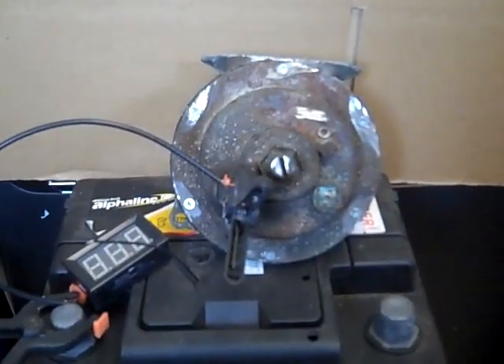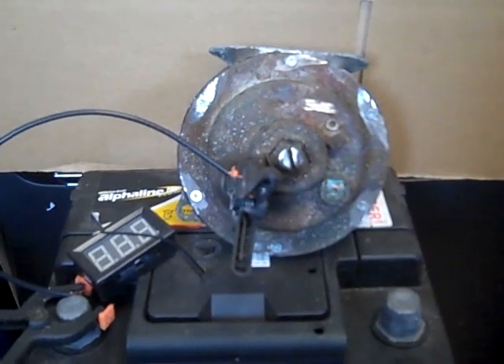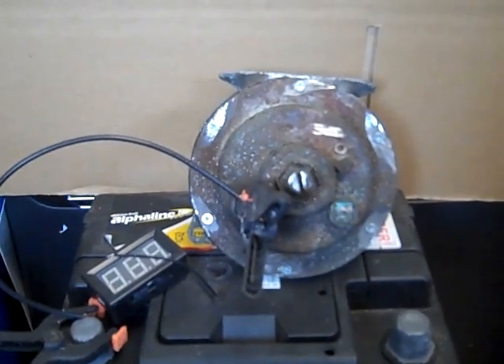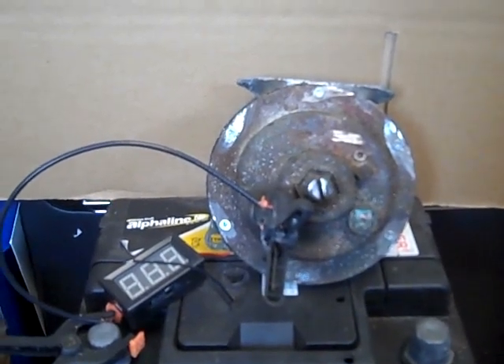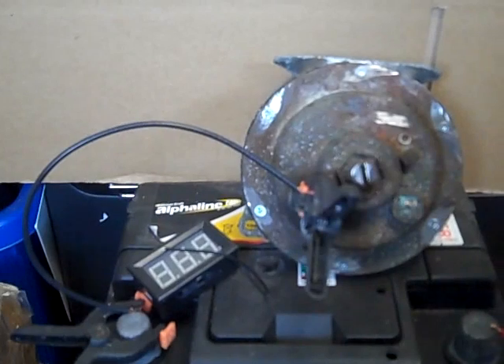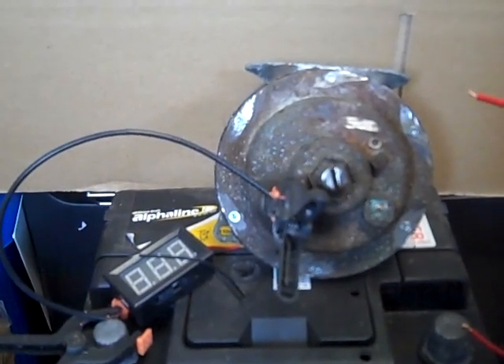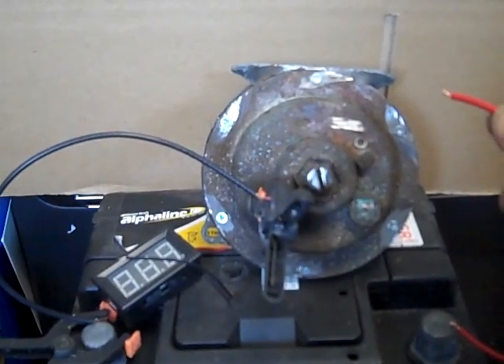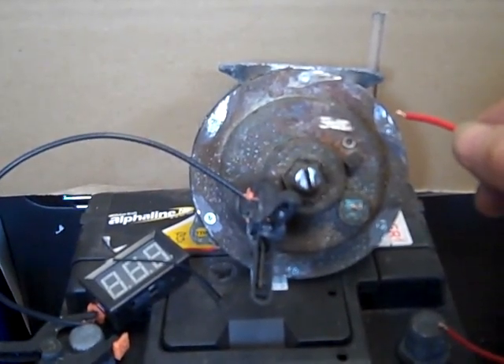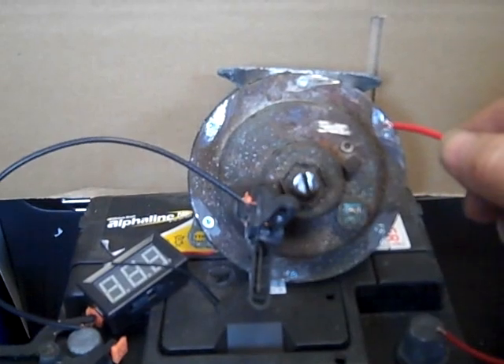We fitted M3 screws around the outside, but ideally they could be M4 — we'd have to drill them slightly. I think that's what we're going to do: take these out and put in M4 screws. That does mean we can sandblast the whole unit, then strip it down and get any sand out of places we don't want it, which we'll manage by just putting some rubber in the actual front part of it.